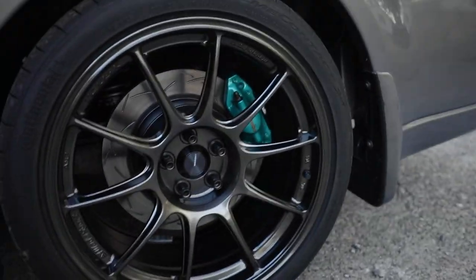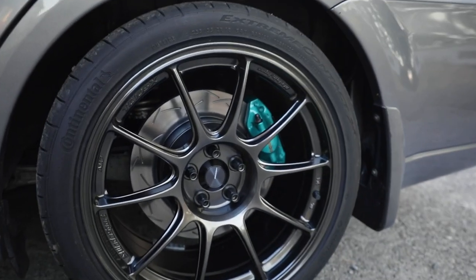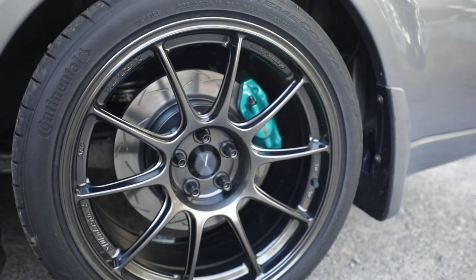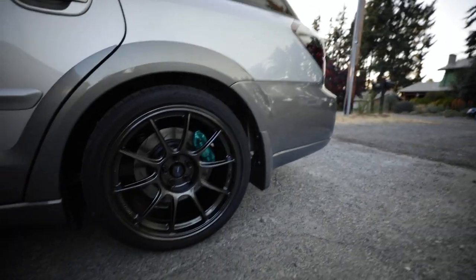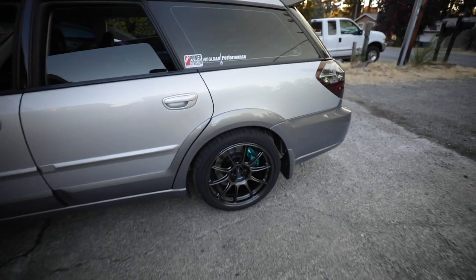I'm going to have to raise it up, take the wheels off, and actually get it sitting proper. I need like three inches off the front and two inches off the back right now. But aside from that everything looks really good - I really like the color combo and how the wheels look. The car rides so much better; I thought it handled great before but upgrading to the Swift springs with 12k fronts and 10k rears made a huge difference even at this height. The brakes stop stupid good. I'm really happy with it, just looks a bit silly right now. That's all for this one - I'll see you in the next one.